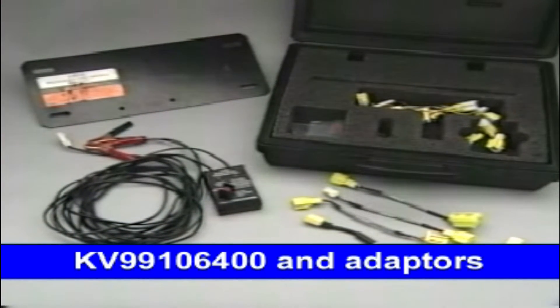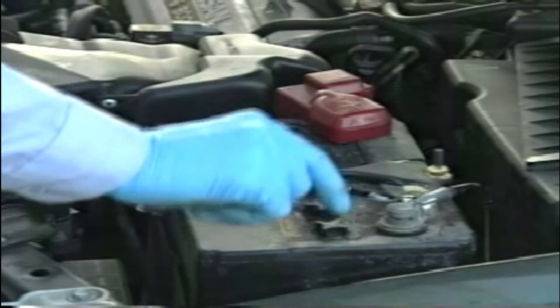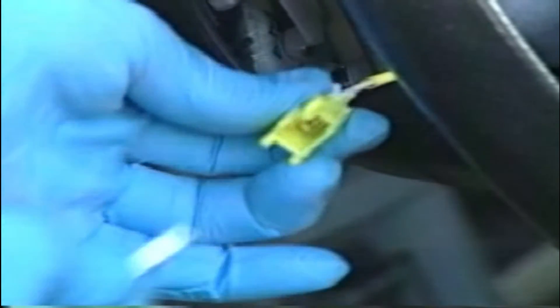This is an essential tool and should be readily available for use. Move the vehicle outdoors with an open space of 20 feet on all sides. To deploy airbag modules and seat belt pre-tensioners while mounted in the vehicle, disconnect the vehicle battery and wait three minutes. Attach the appropriate harness adapter from the deployment kit to the airbag to be deployed.